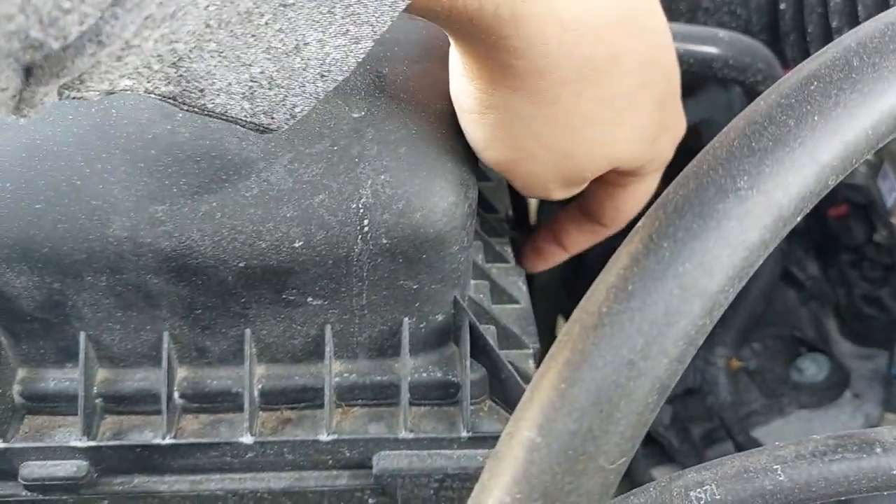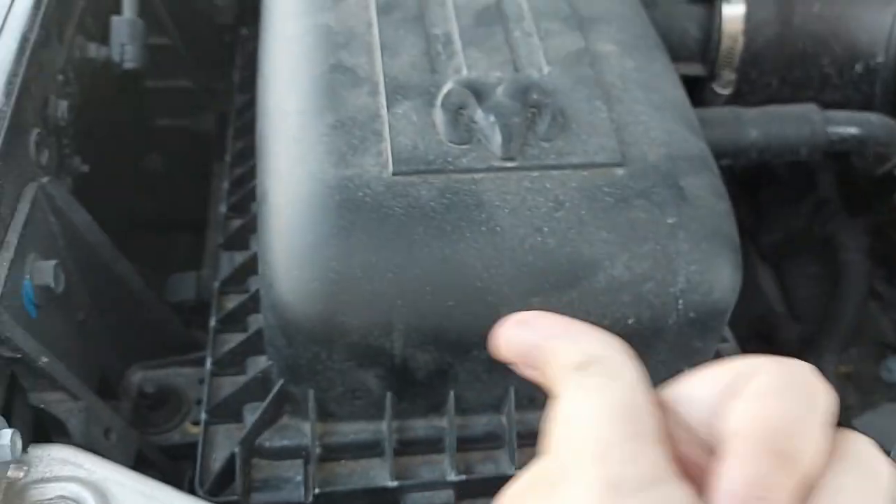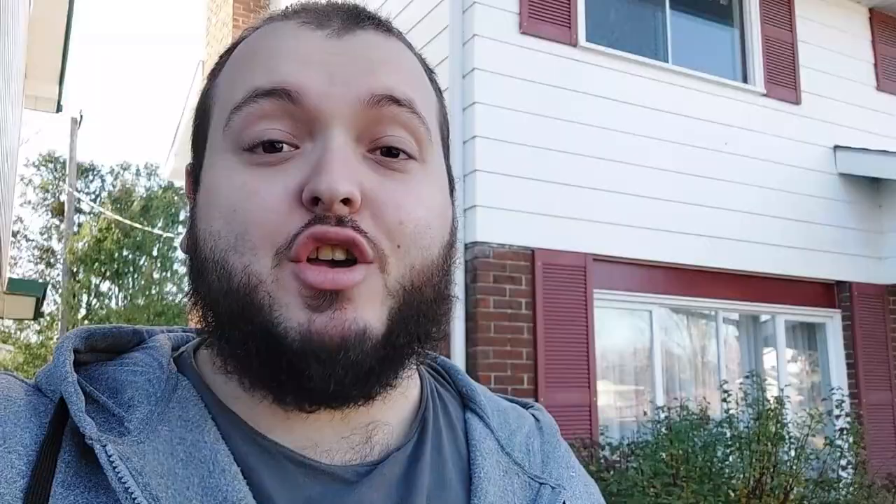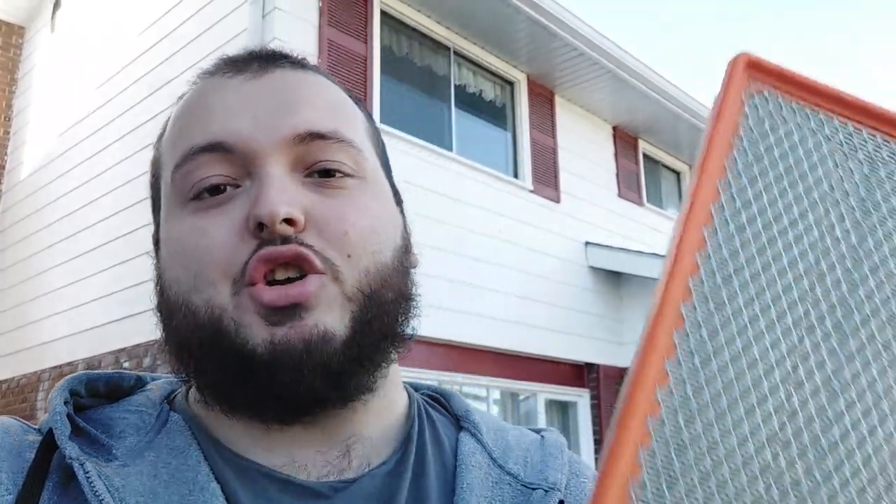These clips here you had to line up and then push it to the left. Now it's just a matter of putting these clips back on and you will be done. Just like that, we are done changing the engine air filter on my Dodge Ram. Again, this should be the same or very similar to all the fourth gen Dodge Rams and very similar to the new gen. Just make sure you match up the same one and get the right filter for your engine size — that should guarantee you have the right size engine air filter for your vehicle. Hope you guys enjoyed this video and there'll be more Dodge Ram videos to come. Please take care. Peace.